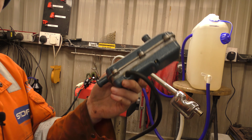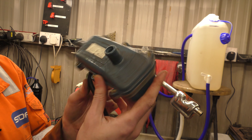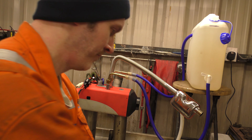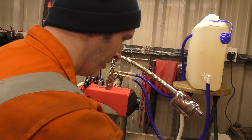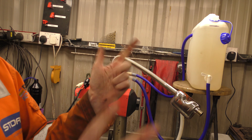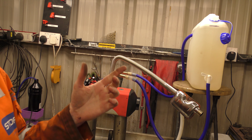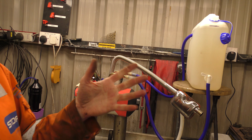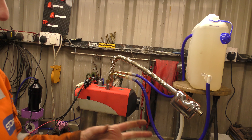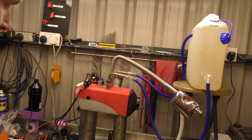That should be a little interesting, and it's here and I've already got it — we don't have to buy any more. You've seen these on eBay. You know what a preheater looks like. Anyway, I've got one of them. So we've got that, the 12 volt Webasto — the actual Webasto Thermotop C or Z — C being the marine version, Z being the car version. They're all basically the same unit, just with various different applications and bits on that side of them. And a 16 kilowatt diesel-fired thing.